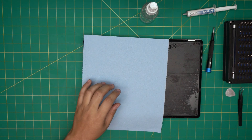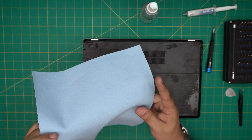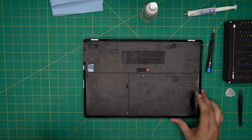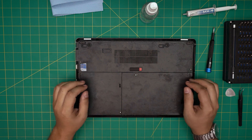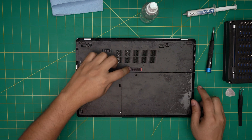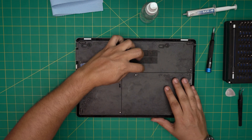With all those tools on hand, let's get started. You'll also need a toothbrush — old or new. First thing: power off the laptop, then flip it upside down. You want to remove the battery by moving this trigger all the way to the left side.